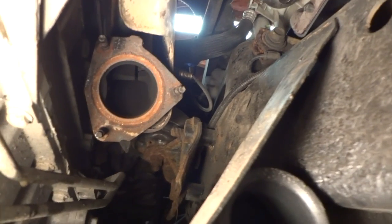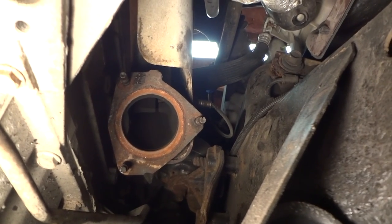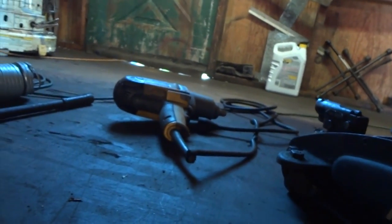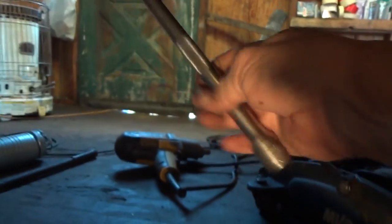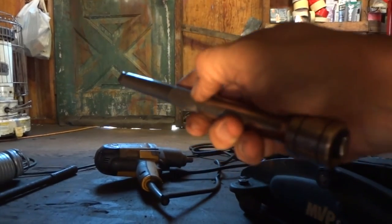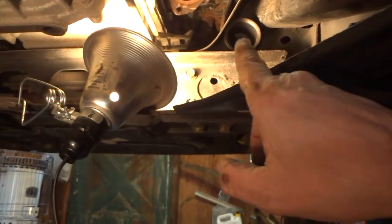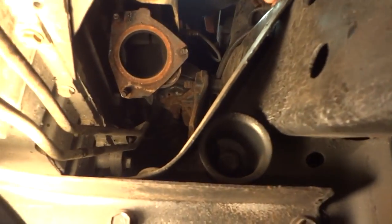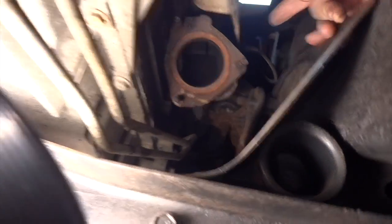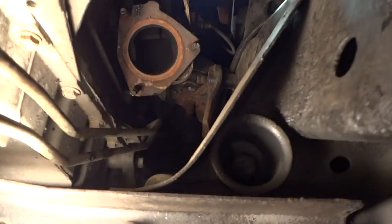There is enough room here. What I would do first is try to get your 15mm socket on there. You've got to use a 6-point — don't even try using a 12-point, you'll round it off. Get your 6-point on there, and if you can't zip it off with that little electric gun, you've got to use it directly to the gun so it doesn't flex. What you need to do is put a 15mm socket directly to the gun, because you don't want a bunch of flex extensions on there — it will flex and jerk and all your torque is not going to go to the socket. Even if you can get the converter out and get a reciprocating saw blade up through on the outside, stick your blade in through here on top of the frame and cut this pipe completely out — you will have a lot more room. I should have done that first.